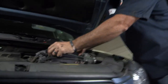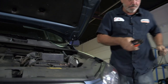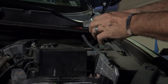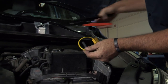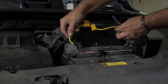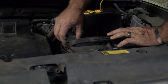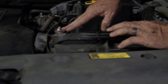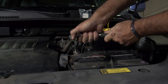Now I'm going to cut it to fit and get rid of all the extra wire. Our next step is to attach the provided fusible link to the battery post. It comes in a loop, so we'll cut it right down the center — that'll allow us to attach one end to the positive side of the battery and the other end to our wire that we ran. On the battery post, looks like we have two attachment points — one here and one here. We only need one, so I'm going to use this top attachment post, sized to a 12mm socket.